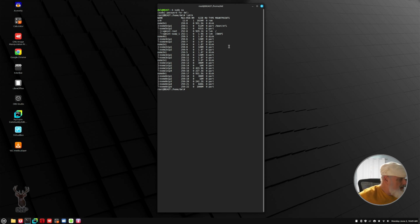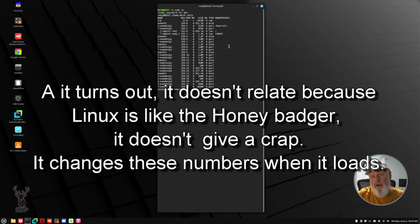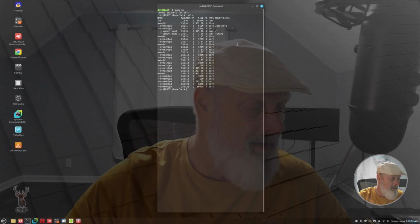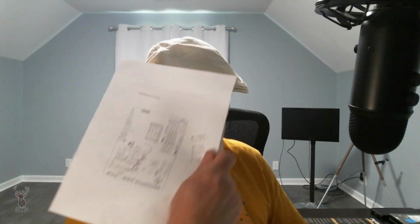Now here's where we want to look at our old hardware. Now, let me get it on camera. All right, because if you remember from the previous videos of this year, I think I did one in there, I said, did you recognize my mistake? Because I put one of the RAID drives in 4's position, or NVMe 4. It was actually called M.2-4 or whatever it was, the 4th one, because you can't use the card slot and that one because there's 4 lanes there. The 4 lanes can go to either the M.2 slot or the PCIe 2 slot. That's what that shows here.